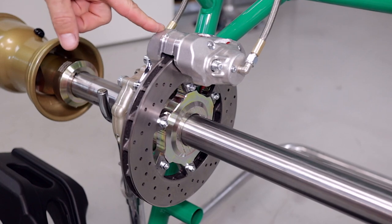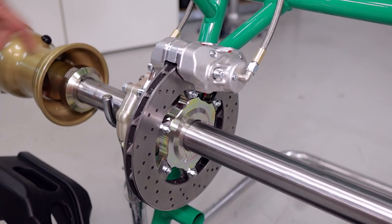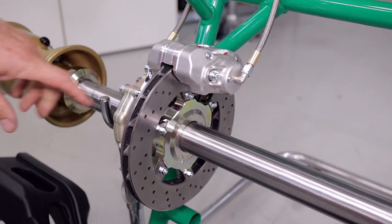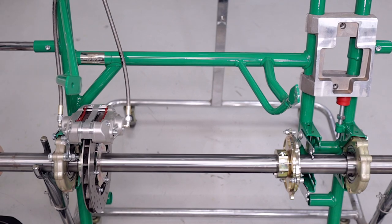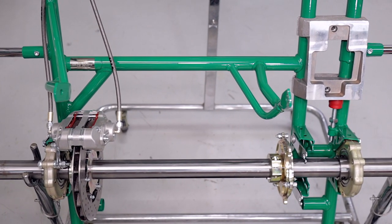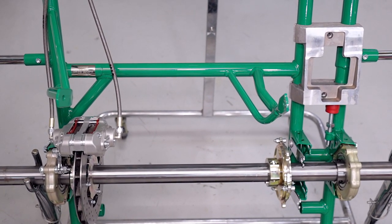Another key feature of the Tony Kart 4SS racer is the BSM brake system. These bigger brake pads — you're never going to wear through those, especially with this 206 16mm ventilated brake disc. You'll also notice that we've got the straight bar design from a few years ago on the old racer, and we're bringing that one back here for the 4SS guys.